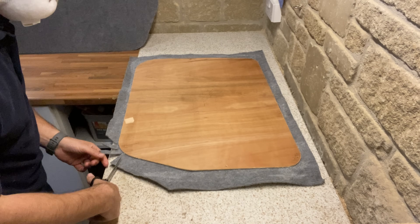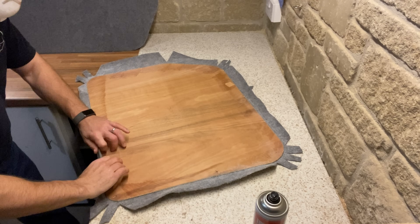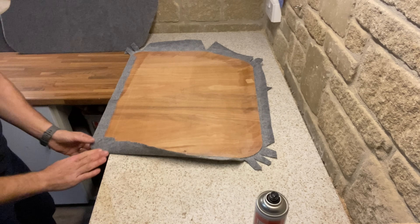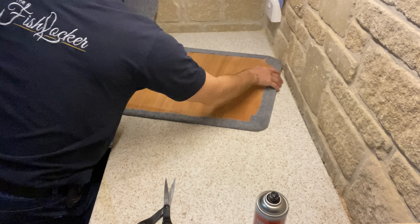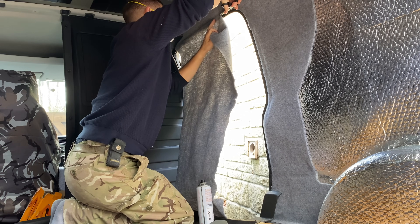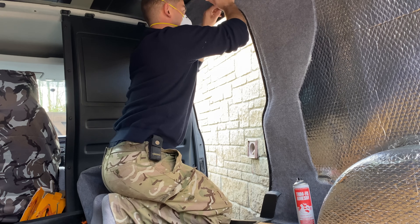Most people opt for an all-over one-piece fitting with no seams, but the problem with that is if you ever need to get behind it to change some wiring or insulation you have to tear it all up. I decided to fit the panels and the little bits in between. It meant more work and more fabric, but it leaves me the option to get behind the panels later. I got seven cans of Trimfix adhesive and used six of them, so it doesn't go a long way — get an extra one. To fit the fabric, spray adhesive onto both surfaces, wait until it's tacky and then lay it tight with no creases.